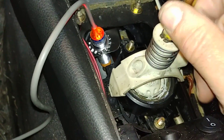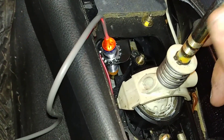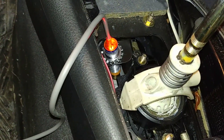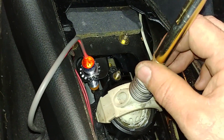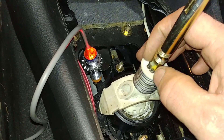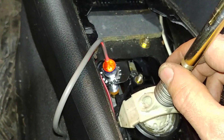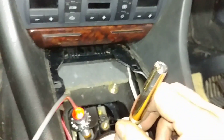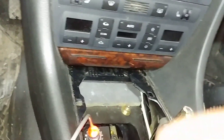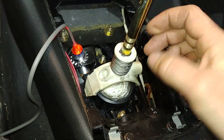The sensor is designed so it will never fail closed, so worst case it just won't start — which is nice. If it were to come out of adjustment there is a possibility it could be sending a ground and the car could start in gear, so I'm also going to wire an LED in place, likely hidden near the headlight switch — just a little indicator that the car is in neutral, since all this will be covered up by the plastic, shifter boot, and trim.